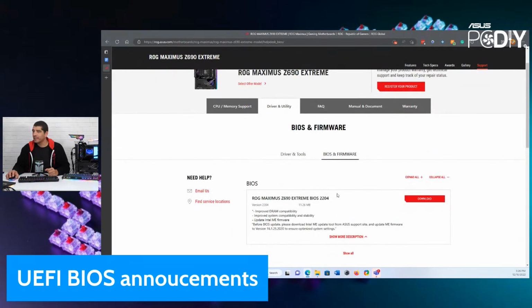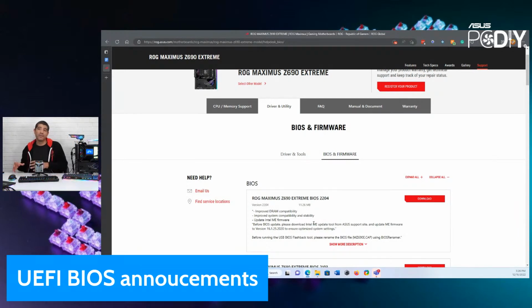Okay, but the important thing that I want to note right here is that if we actually head over here, you can see this is the build 2204, right? But the important thing is that with the last couple of Intel updates, there's critically also been not just that primary BIOS update, so that UEFI BIOS update, but there's also been management engine firmware, and then there's also been a management engine firmware driver, right? You need to have all 3 of these. So the UEFI BIOS, the MEI firmware, and the driver ideally all want to be updated. And generally when you complete all these, I would also recommend you reinstall your chipset driver and you reinstall your graphics driver to hopefully have the most streamlined and the best experience when it comes to that.